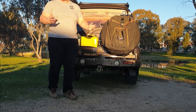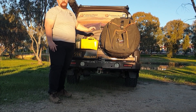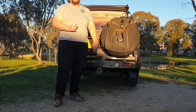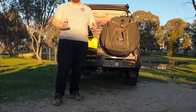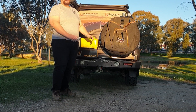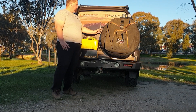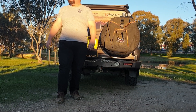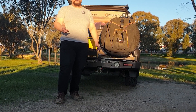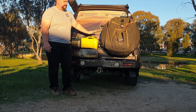The other reason was the spare tire. I run slightly oversized all-terrain tires, and on these later-model Pajeros the rear tire mounts on the rear door with a little scallop in the tread area on top of the rear bar, so you really can't fit anything larger than a standard tire. For a while I was running four oversized all-terrains and a standard-size road tire as a spare, which was pretty risky. I know you can get brackets to lift the spare tire mounting height, but if that was my only issue I probably would have gone down that road.